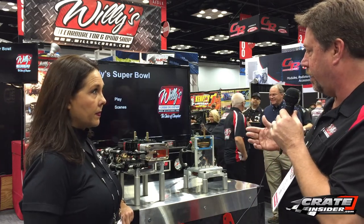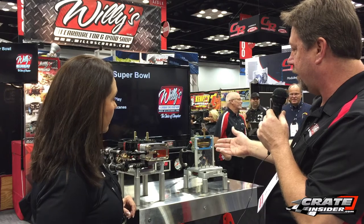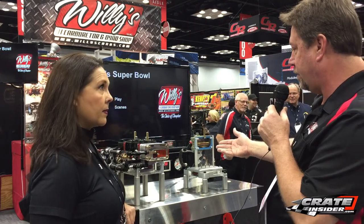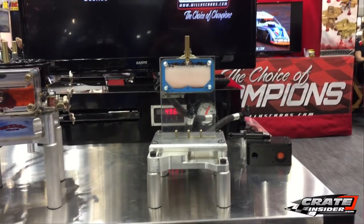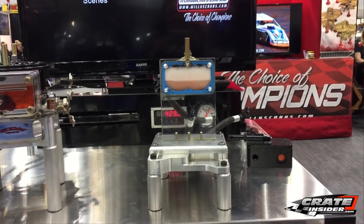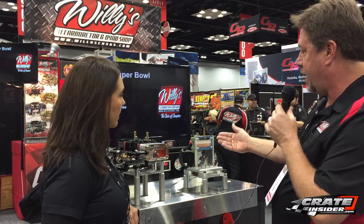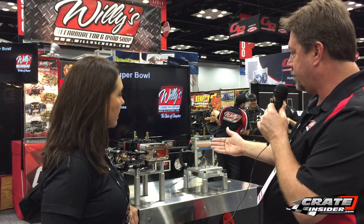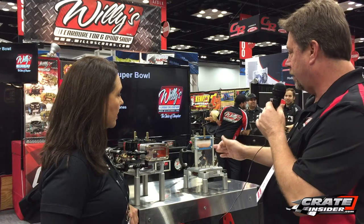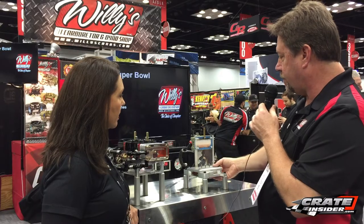I'm going to show you here — we're going to turn the fuel pressure on and show you what it looks like in a conventional style Holley float bowl with a needle and seat. This represents 8,000 engine RPM. As you see, all the fuel is aerated. The needle, seat, and float are trying to adjust to keep the engine alive because the float has to drop and the needle seat has to open to allow the bowl to be refilled. This is what we end up with at the end of the straightaway. As the racer enters the corner, you'll notice there's a jet on each side of the center line — notice how the liquid strays away from it.